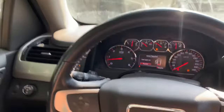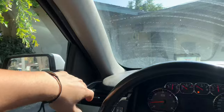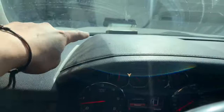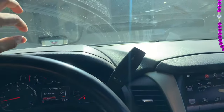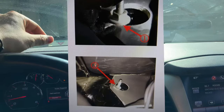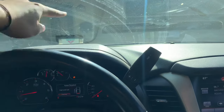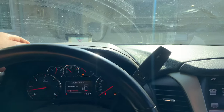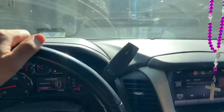I've already checked a couple of things. If you take this panel off — there are a couple of videos you could watch — take this panel off and take off part of this cover. There's a ground somewhere here and there's a ground on that side too. You can check to make sure it's making contact, because I've read online that there's something that gets in the way between the contact of those two grounds. I already cleaned them — that wasn't the issue. The issue with this one was actually the ground cable going to the battery.